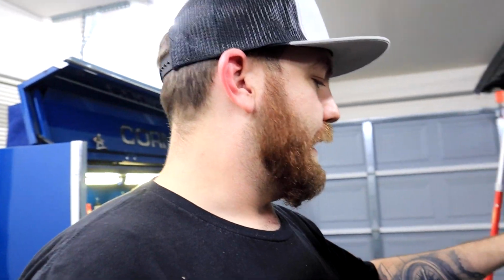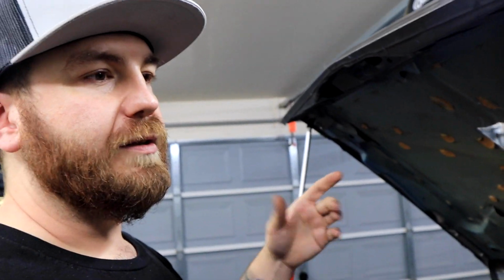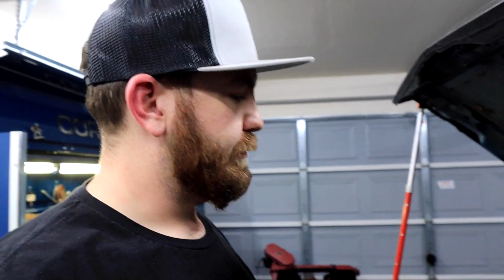So that's the vent tube extensions for a blow-through carburetor. I didn't really need to do it yet. I'm not to the point where I'm running out of jet. Most guys will do it when they've got 100 jet size in the back and they're drilling the jets out, or they're using E85 or alcohol where they just need way more fuel. But for right now, I'm doing all right. I was just doing it as something to do.